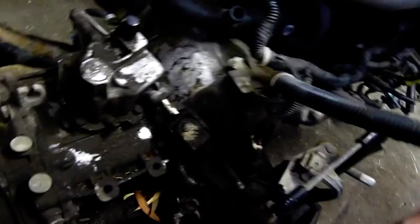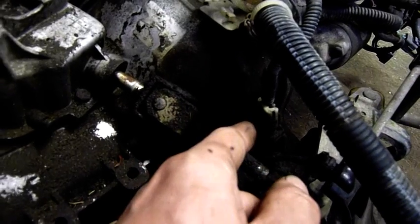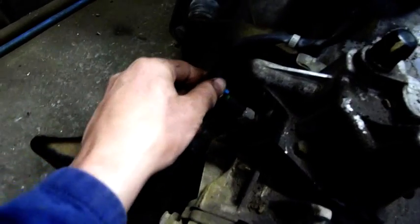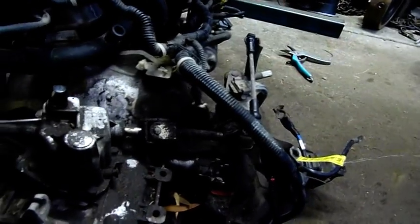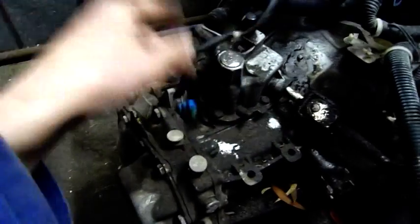The main thing is to separate the looms. That I believe is the signal sender for the speedometer, because it's running off the differential. That one has two wires on it and comes off from the gear selector, so that's the reversing light switch — when you throw it into reverse, your reverse lights come on thanks to that little switch. There's no need for three wires on a reversing light switch, and that's going on to the diff, so that looks like an inductive pickup, similar to a crankshaft position sensor. So that'll be the speedometer signal, because it's a digital speedo and odometer.